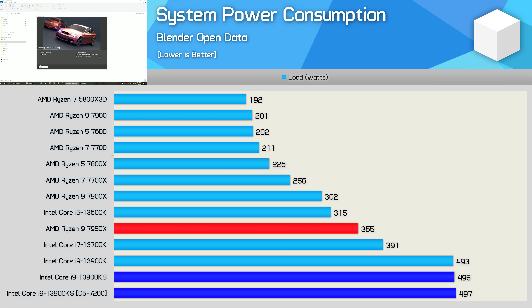The only impressive aspect of the 13900KS so far is power consumption, and although power usage in general for these Core i9 parts is very unimpressive, relative to the 13900K we're getting a little extra performance at no real cost to power usage. The higher-quality bin silicon is able to run at slightly lower voltages, resulting in the figures we see here. When compared to the 7950X, total system usage is around 40% higher with the i9 part, which is really bad given the Ryzen 9 processor was 12% faster in that test. So the 13th-gen Core i9 series is a disaster for productivity when it comes to power usage, and while you can limit the power, that does limit performance, handing the 7950X a larger performance advantage.